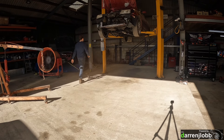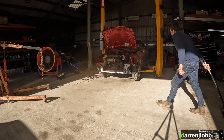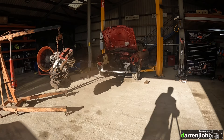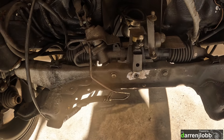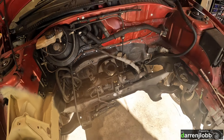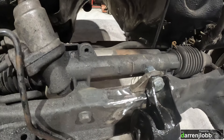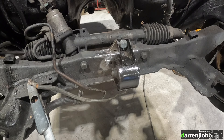Let's take this engine out again. Now that we've got the engine out, we can get down to the subframe a bit better. I'm going to cut this gear turret off completely because it's for the linkages on a Peugeot box — the Honda transmission is cable shift so we don't need any of that. I've pulled the engine out to sort out the top of that lower mount. There's a factory bracket on top that I've left on because it worked out perfectly for a top bolt. I've cut a little piece of plate and I'm going to tack weld that while it's all bolted in position, then unbolt the mount, weld it fully, put a splash of paint on it, and that's all three engine mounts tied up. Then we can start moving on to the next project, which is probably going to be measuring up for the drive shafts.